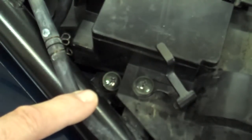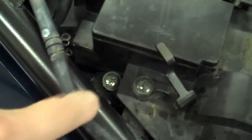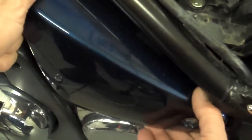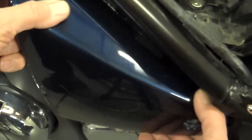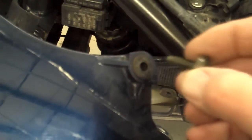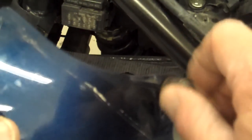To remove the left hand side cover, just take the screw right here — this is the one just ahead of the one that holds the battery and tool kit on. Remove that screw and then pry the side cover off. It's held by three little rubber donuts so you kind of have to pry on it. Pop that off and there you have it. One quick note: whenever I take something off, I go ahead and put the screw back in the hole so you won't lose the screws — that's a good habit to get into.